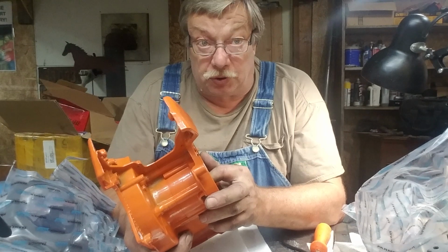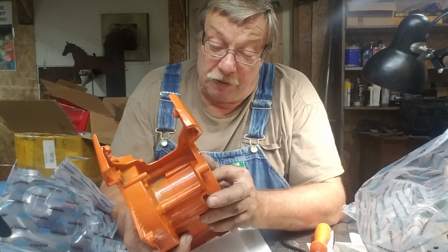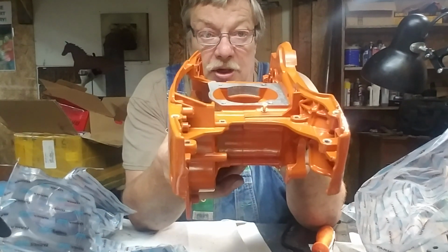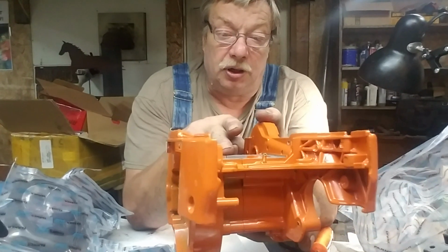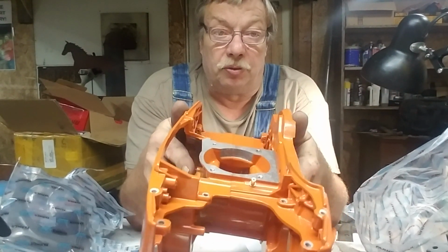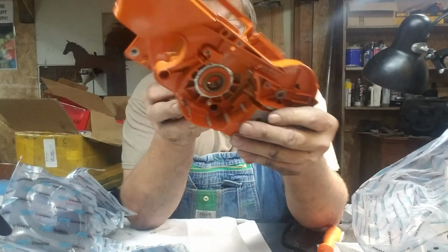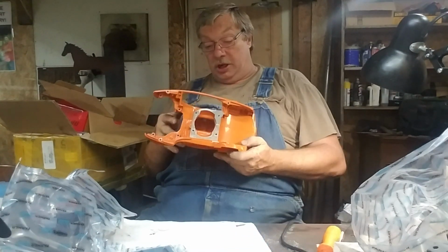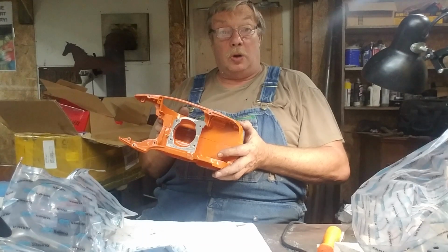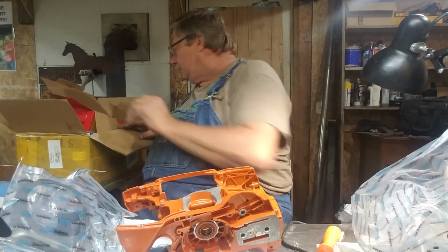The seal feels the right stiffness. It's not soft like they used to be, and it's not brittle hard. The machining on the top of the case, you can't see it here, but there's a little corrosion, which I'm not too concerned about. It looks good. The last ones I used, all the bolts went in and I could use OEM parts, no problem. I think we got a winner here.